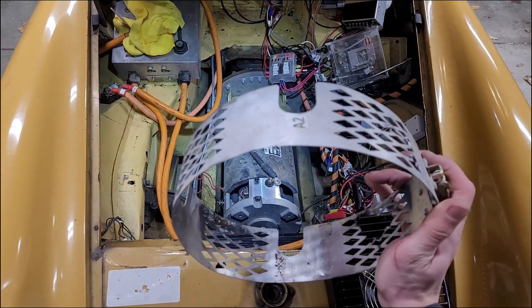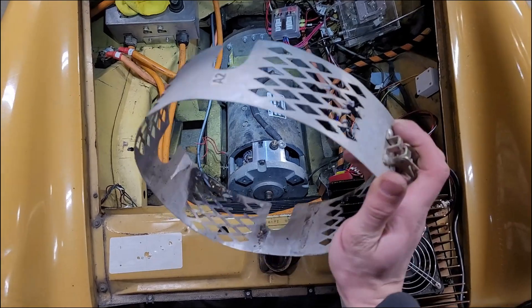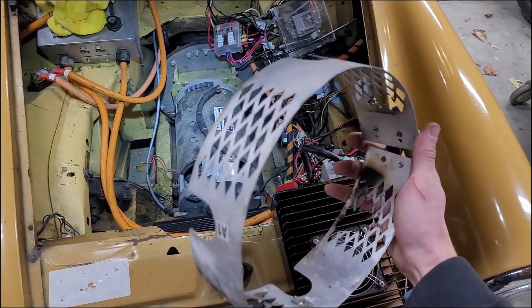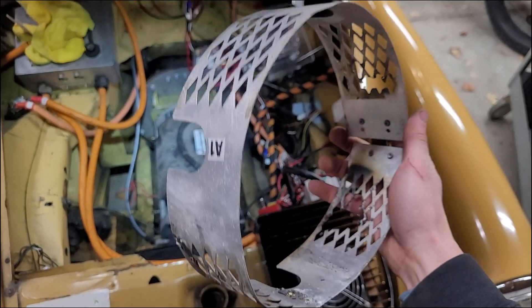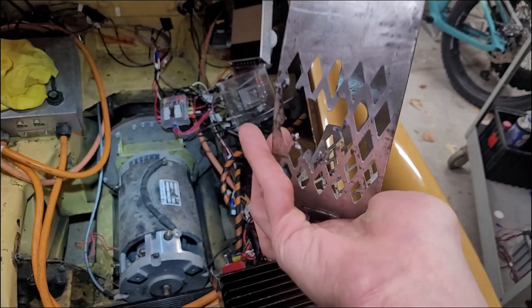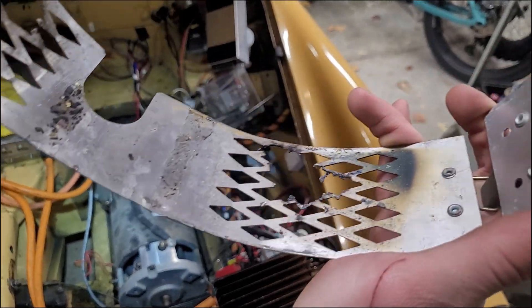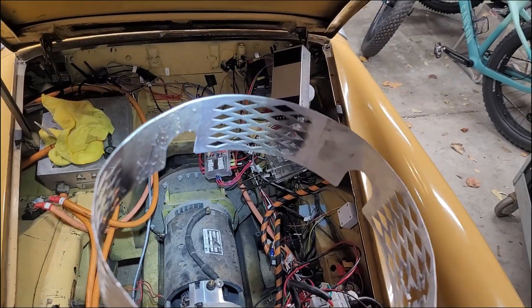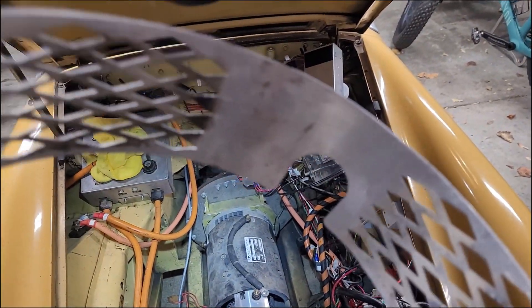Here's how this band came off with the A2 on top. You can see that was the place I pointed at on the side. Top left is clean, but that's scorched, and that's especially scorched. All of that got hot — so three quarters of the motor got hot.